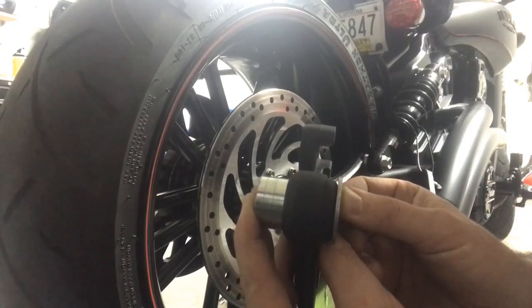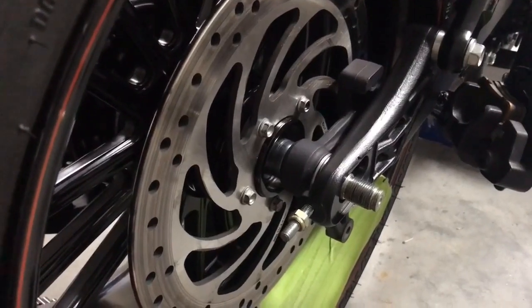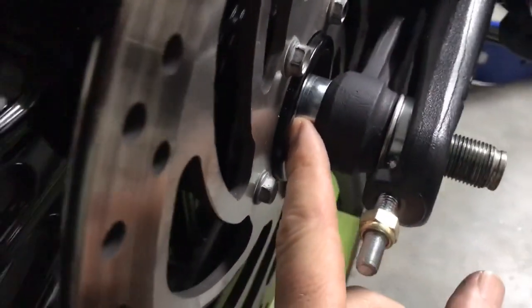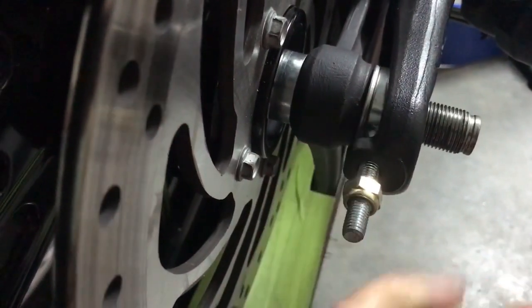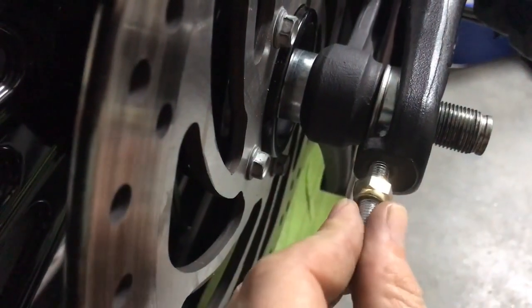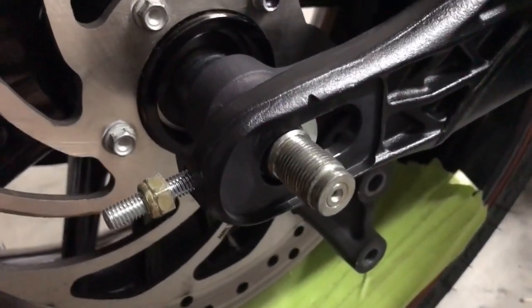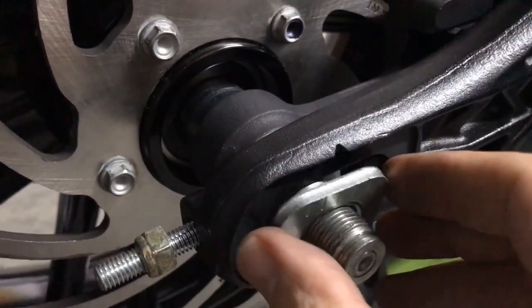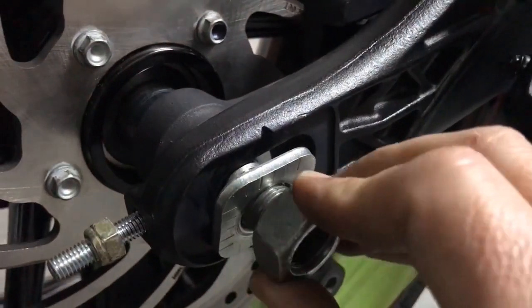Slide the axle through those and we'll put everything else on the outside of the swing arm. There's the thick spacer removed from the stock wheel, your brake caliper mount, and the thin spacer. Remember that part of the hub is not a spacer — it's part of the wheel itself. So three pieces: one, two, and the thin spacer. On the outside we're going to put the square washer with the alignment marks — those marks are for adjusting your belt tensioner.